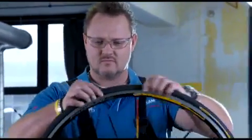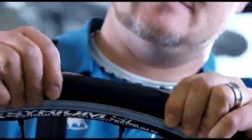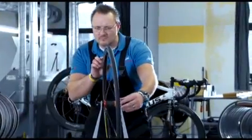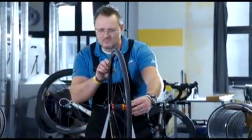Once the tire is in the bed, it must be centered and aligned. Very seldom does the tire run true immediately. Check the tire over the entire circumference. The seam protector must be aligned equally to the left and to the right. If the tread is not centered or if the tire wobbles to the side, lift the corresponding section from the rim, twist it slightly, and let it go once again.